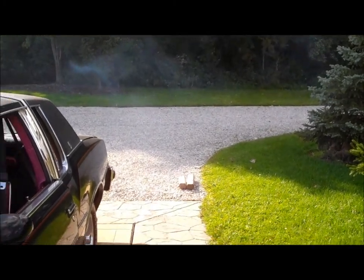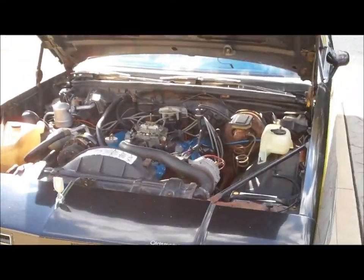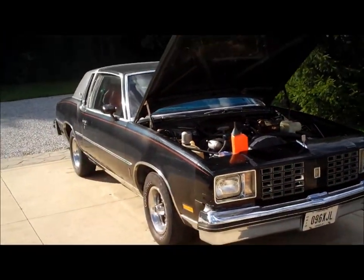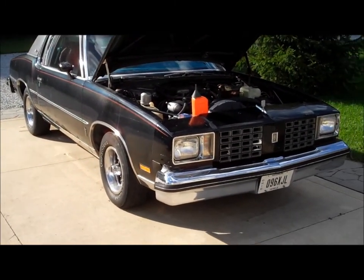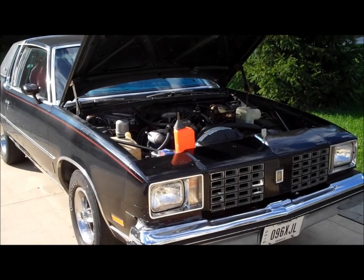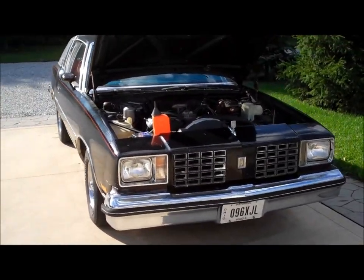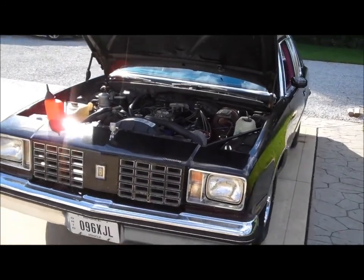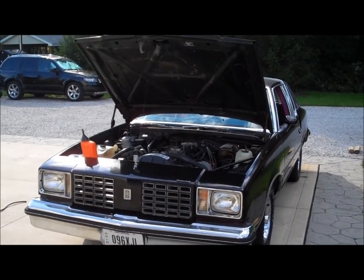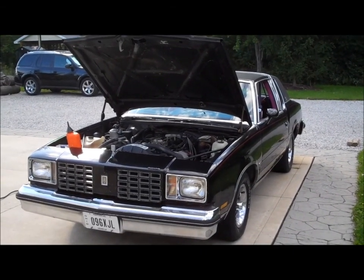A little smoky — probably some oil burning off the exhaust and all that good stuff. Well, that's it, the 403 is running and it sounded pretty good. A little bit smoky, probably just burning off a little bit of oil. I've got a brand new jug of oil and I'm going to change this oil right away before I take it up and down the street for the first time, just because since this motor had some water in it, I put fresh oil in, cranked it over, figured I'd run it for a little bit, let it get hot, then change the oil so it has fresh oil — no contaminants or water. But that's pretty much it. Next video will be the first test drive up and down the street with this 403.